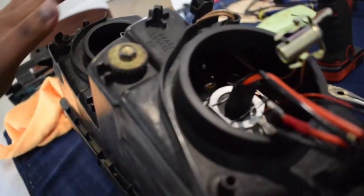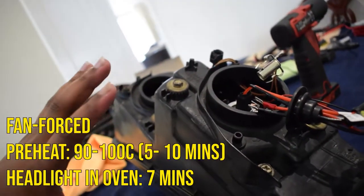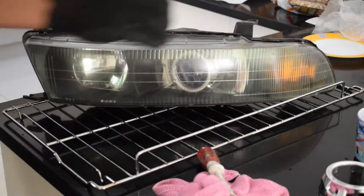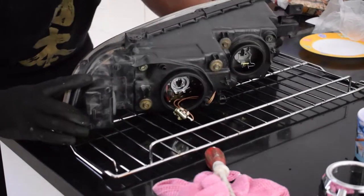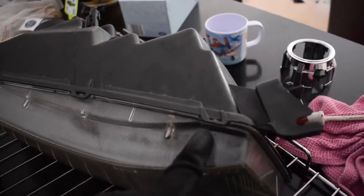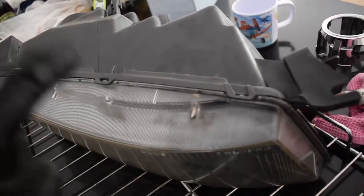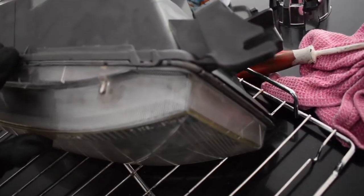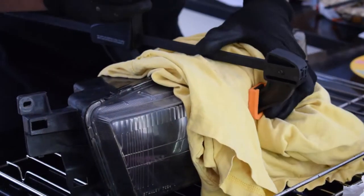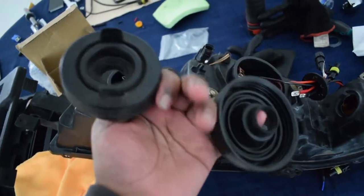We've got the lens seated on the housing, now we just need to remove all the bulbs we put in - make sure your parkers are out and take the HID out. I've set the oven to preheat at 90 degrees Celsius for five minutes and then we can put this in. The key to putting it back together is while it's still warm you're gonna put the tabs back over the clips - make sure the plastic is sufficiently warm because otherwise it'll break instead of bend. While it's still warm go put some C clamps on it to hold it together and let it sit for about an hour.